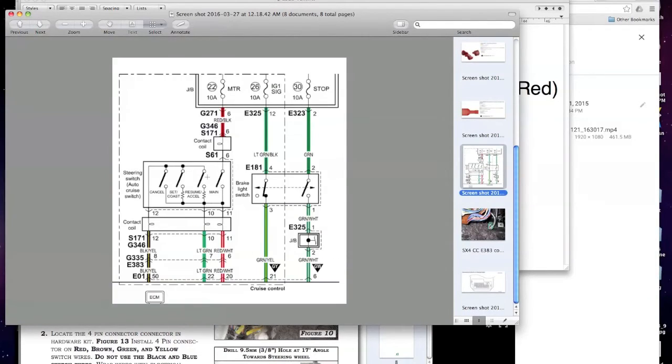Okay, so let's take a closer look at that again. So there's your power. This is coming out of that 346 connector. It doesn't seem like it, but there it is, 346. It's all the same. Just pretend it's pin 6. And that's going to go into a male spade connector, and over here, just before the fuse, you're going to have that T-tap on, and this is going to plug into it. So there's the male spade, there's a T-tap, just imagine it in this wiring diagram.